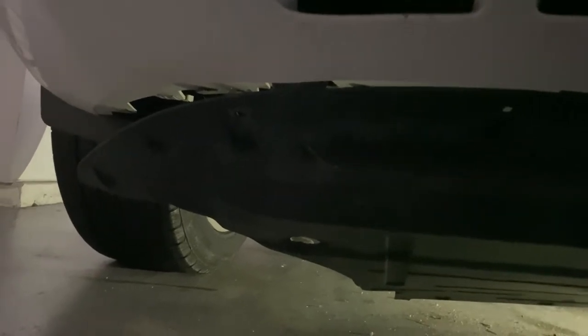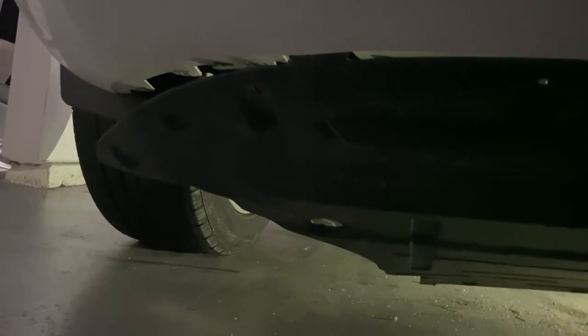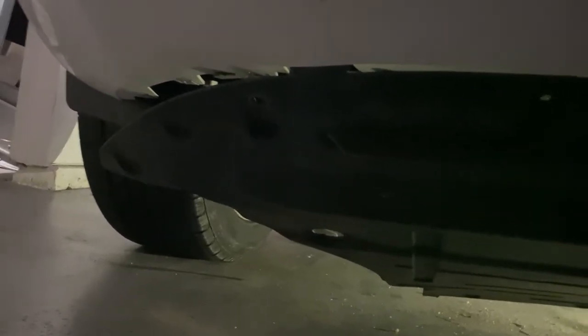Okay, so I'm on the second plate underneath. You actually need to remove that completely. You have a couple you can get with a flat screwdriver at the front, and then there will be two T25 Torx all the way to the front of the plate — I think about eight of them total. You need to remove them completely to have access.